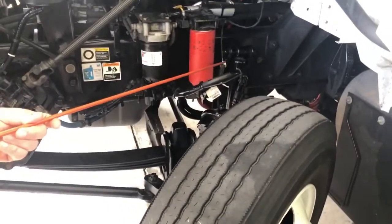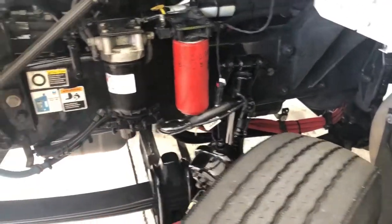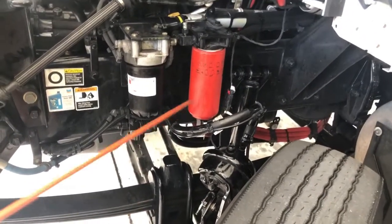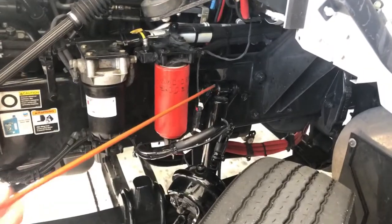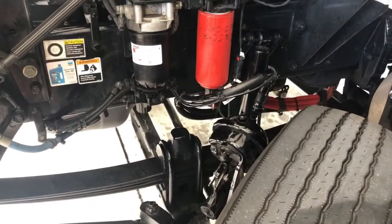I do have the shock absorber standing right here. The shock absorber is securely mounted at the top and bottom of the tractor. The bolts are all in place. The shock absorber is not leaking at all, and all the rubber bushings between the bolts and the shock are in place — not deteriorated, cracked, or falling out.